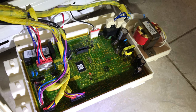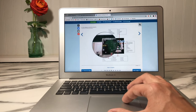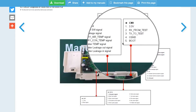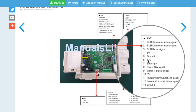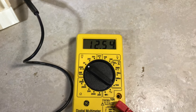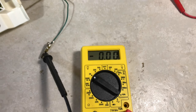Now I'm going to verify that we're getting the correct voltage coming out of the main logic board. The owner's manual diagram wasn't very helpful for this, so I looked for a better diagram for my logic board online and it wasn't too difficult to find. This diagram explains every single pin for each connector on the main logic board. I'm going to inspect connector CN7, which sends power from the main logic board to the user control board. If the main logic board works properly, we should measure 5 volts between pin 4 and 5, or 12 volts between pin 5 and 6. I connected my test leads to pins 5 and 6 and measured a little over 12 volts — that's good. But then I measured between pins 4 and 5 and got nothing — I should be getting 5 volts but all I'm getting is 0.01 volts, which tells me this board is not good and needs to be replaced.